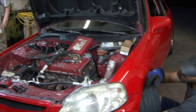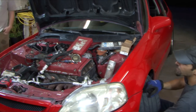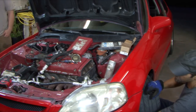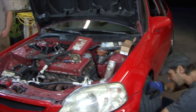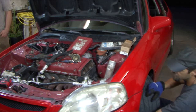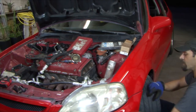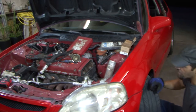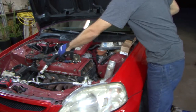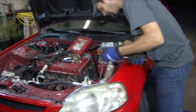Right now we're adjusting and tightening the dryer on the car, getting it all set. The next step is to crawl underneath the car and put the actual compressor on the bracket. If you jack the car up and turn the wheel to the far left, it gives you some room to work. We've got the upper snugged down.